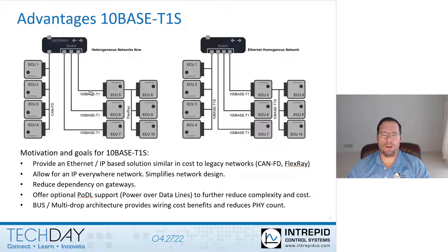The software and hardware of these gateways tends to be expensive and also be the source of quality issues in production. Some in the industry want to move towards a homogeneous type of network architecture where we have exclusively automotive Ethernet used throughout the entire vehicle.